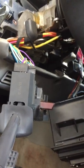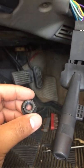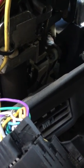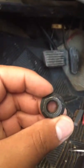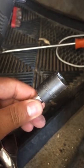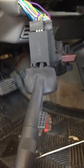While I'm down here — the steering wheel is loose because you have to loosen these two bolts. I had forgotten about these and couldn't figure out why the dash wouldn't come up. There are going to be two bolts on each side of the steering wheel, and the socket size is 15mm. Those are actually the last ones you'll need to remove, and then it should pop right out.